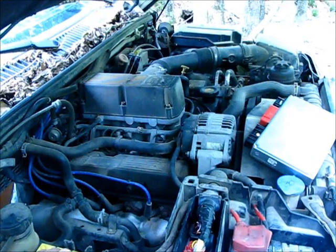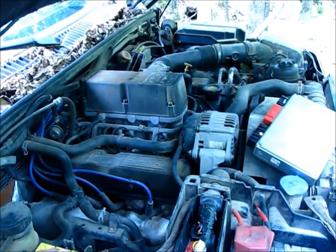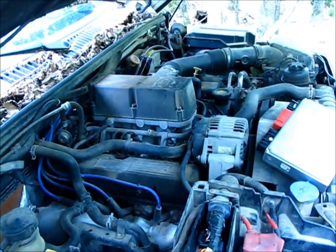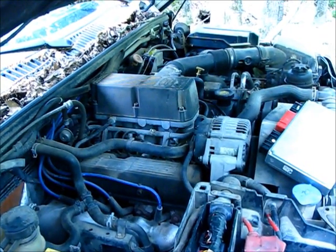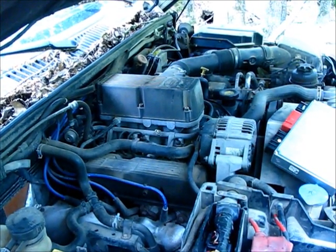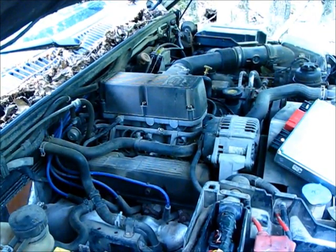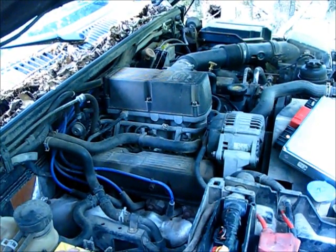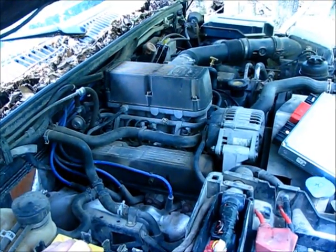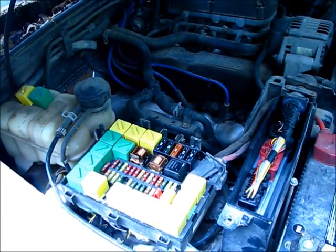So what we've got now is the 4-liter engine, the V8, running with a hacked ECU module in a standalone mode, which means the car still thinks it's being stolen, but the engine runs — which is what I'm happy about. I've still got some rewiring to do, because it's not real practical to get out, pop the bonnet, and pick relay 15 and 16 to start it. But I wanted to thank you guys again, Joe and Clark, because without your incessant pushing, I probably would have just parted this thing out. Runs like a dream. I'm back in business. Thanks guys.